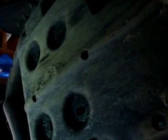Alright. Next up is remove these four bolts from the transmission mount. I'm going to get a wrench on it, 15 millimeter, using a deep well. Then support the transmission, which I'll do with probably the jack that's in my car because I don't want to use a big jack for this. I'd almost rather have it under the front just in case. Yeah, I'm going to go and do that. Then remove the cross member, and probably my skid plate since he doesn't say anything about it.